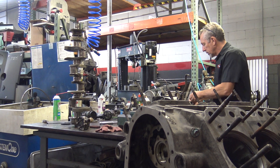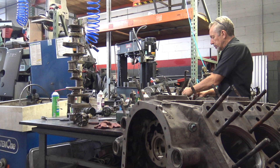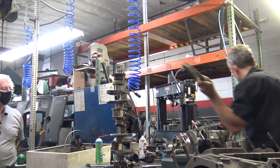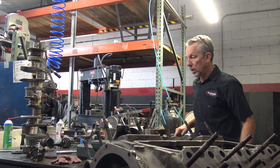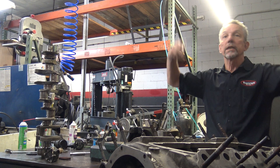This does not have a chain — this has gears. This is your camshaft gear that turns on that one. That's high quality; it's expensive. That's why most other manufacturers use chains — it's cheaper. Plus when you go to overhead cam, you've got to have chains.